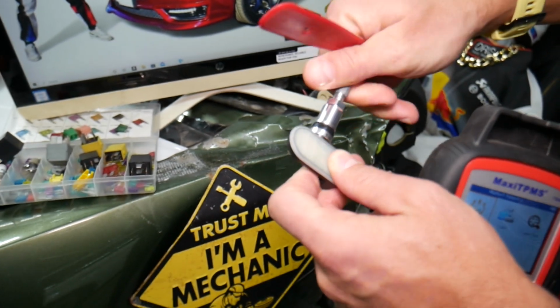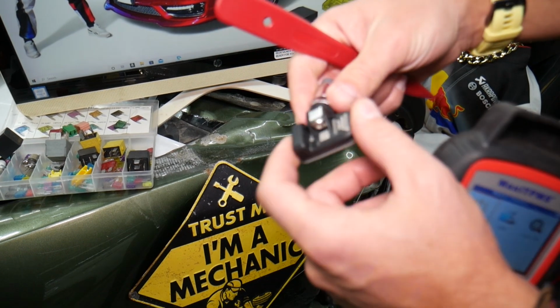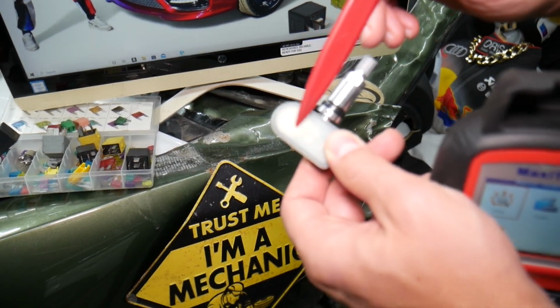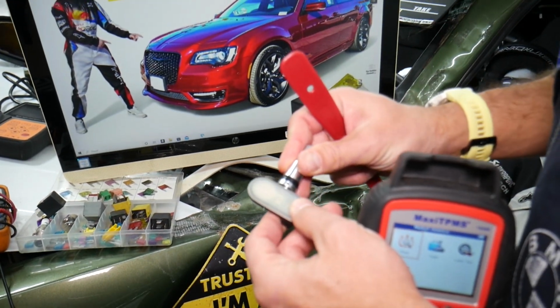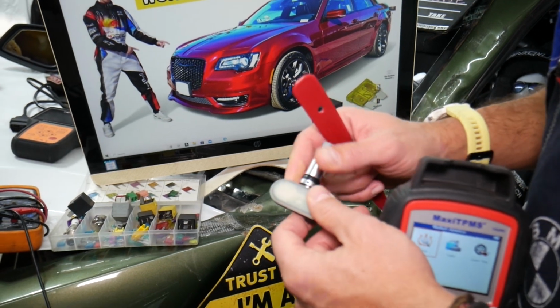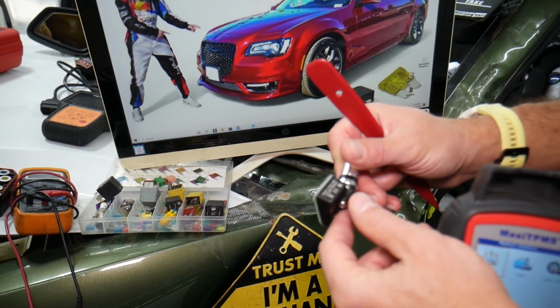And that portion of the sensor, that's the seal that goes around the ring right here. And that portion is in the wheel. Here you have a battery. You can kind of see it through the cover, that circle battery. Eventually they do fail. Sometimes they get cold, they get old, they fail. And that can trigger the light. After a short drive sometimes or warming up, you may notice that it starts working again. That's normal for other sensors.